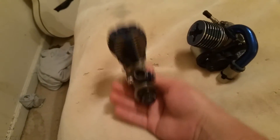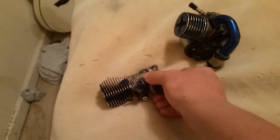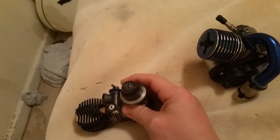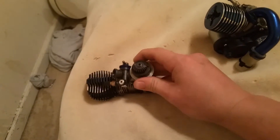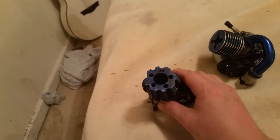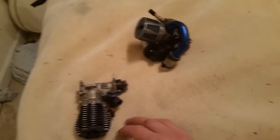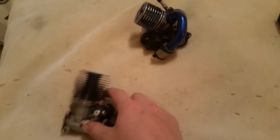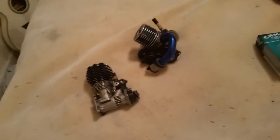Most nitro engines, if you're looking at the front of it, are going to spin counterclockwise. If you want to see if a nitro engine still has good compression, rotate it counterclockwise. If it is difficult to do with one finger, it still has decent compression — also known as a pinch. You can also take the head off, put some WD-40 on it, and as long as WD-40 doesn't leak down the sides of the piston, that's a decent indicator. It's not a foolproof method, but you can still get it running — it just won't run at 100%.